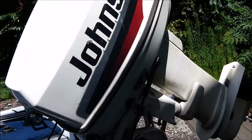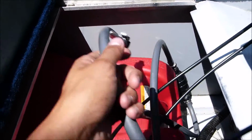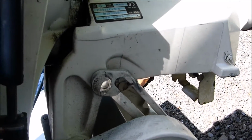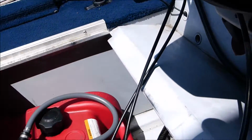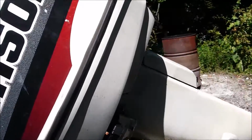Now anyways, this outboard next to our fuel tank, or the fuel line, just plugs in right here. Oh, I think I got it upside down. Plugs in right here. And then just squeeze the ball, get a vacuum started, brings the gas into the tank. Which last time we didn't have gas, so that didn't help us very much.